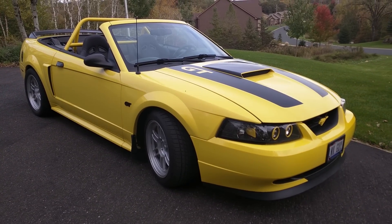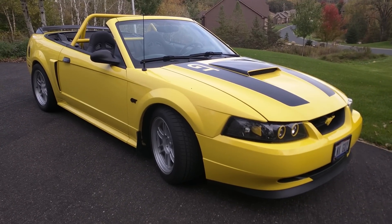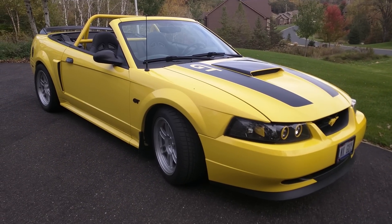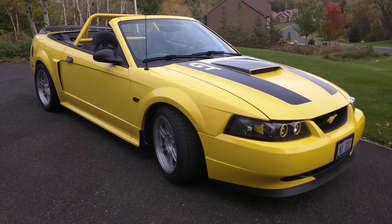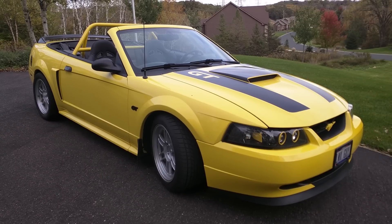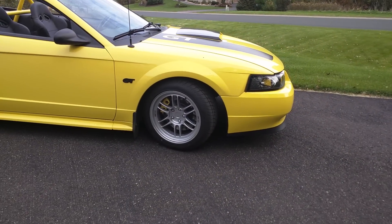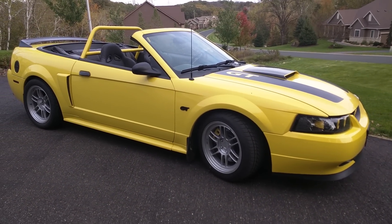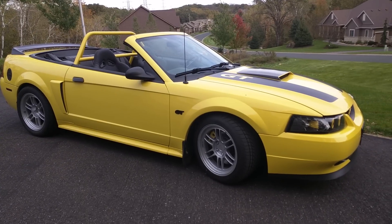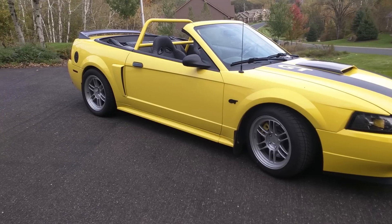It's just going to be bulletproof, and you're not going to have axle wind-up and all the other issues. My weight stats are in. The curb weight of my car is 3,460 pounds, which was what it weighed before the swap. The major difference is it's 1,850 over the front axles and 1,610 over the rear. Those numbers, if you take 60 pounds off each one, are what I had right after the swap with the TR3650 transmission and no bracing. With the stock chassis components, this car was quite terrifying to drive, and it's kind of not gone that way now.